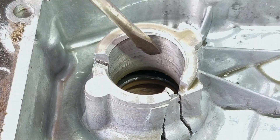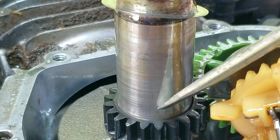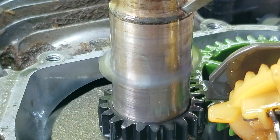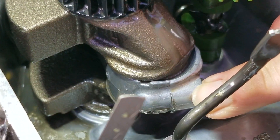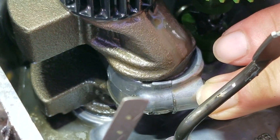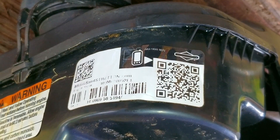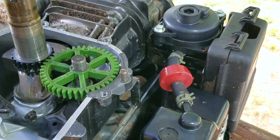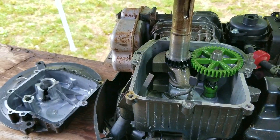The bigger question is how much is it going to cost to fix this? The items I need to replace are the sump, the crankshaft, the oil seal, gaskets, and the blade adapter. If I bought the parts new, the price after taxes would be more than $210, which is very close to the price of a new engine. If I bought the parts used the price would be about half, but I'd still have to buy a blade adapter for either choice. I don't have an issue with spending a lot of time on a project like this — it's a hobby and that's where the enjoyment comes from. But what I don't like is money coming out of my wallet that I can never get back, so this project may not be worth it because of the high price for parts.